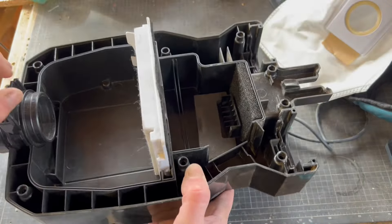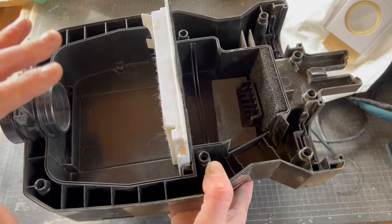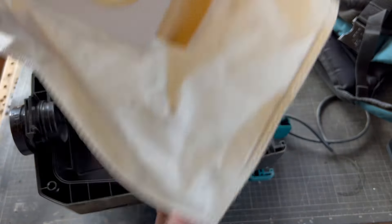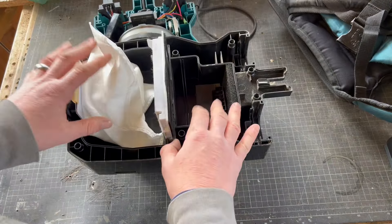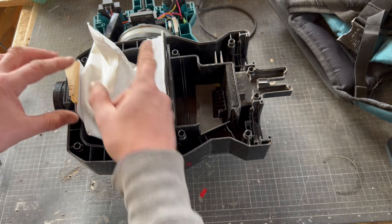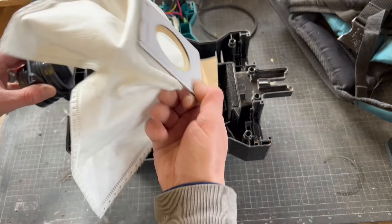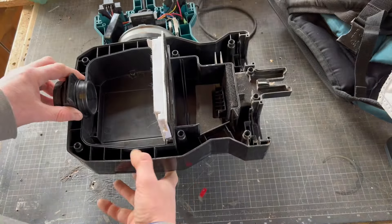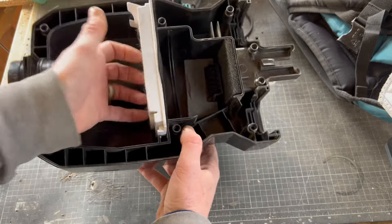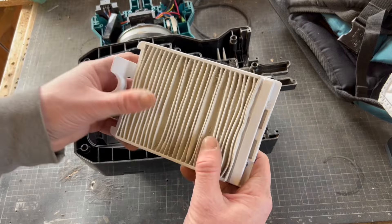So I'll explain why I think this lost all its suction - it was hardly working. First things first, I think the chaps who were using this before me haven't been using the bags that go on to the end there. I bought these bags - they didn't come with it. So I reckon this vacuum has been used without the bag, meaning it got absolutely full or they just didn't have one and thought it'd be all right - and it plugged up on the HEPA filter.